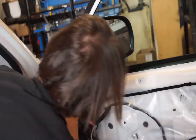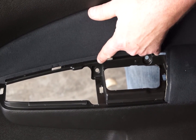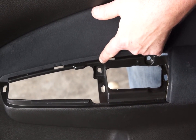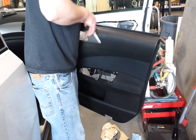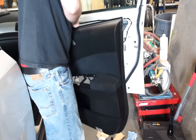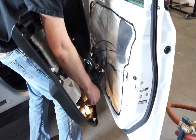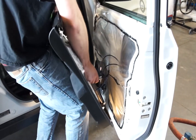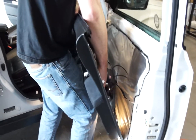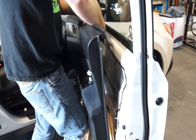Here I'm test fitting. These are the two additional screws underneath the switch panel that I was talking about at the start of the video. Now that everything's tightened down, all we need to do is reinstall the door card. First, connect up all the wires. Pull through the cables for the switch panel, and then remount the door handle.